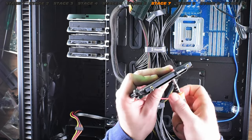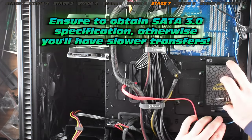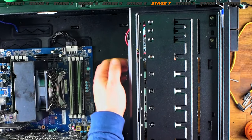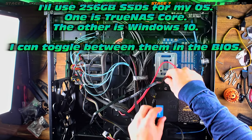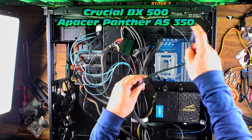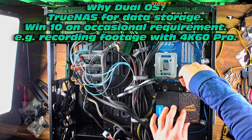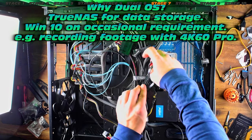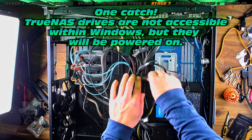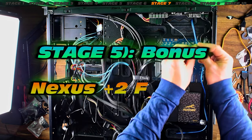You can optimally organize these hard drives and decide how you want to arrange them. In my case, going for a very convenient setup where most trays are occupied. I'm also going to install some 5.25-inch bays — I'll show you that shortly. For now, I have two SSDs in here because I'm going to run Windows 10 and TrueNAS Core — a dual-boot setup. I just toggle in the BIOS which one I want to run. That gives me the opportunity to record 4K footage in Windows and then transfer through TrueNAS, plus 10 gigabit connectivity for really fast transfers.